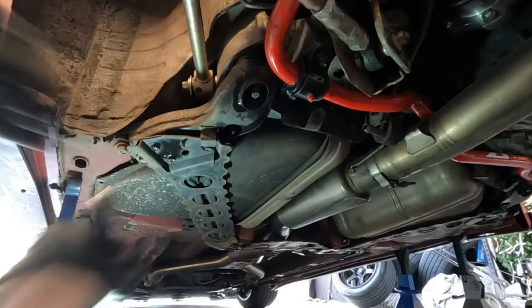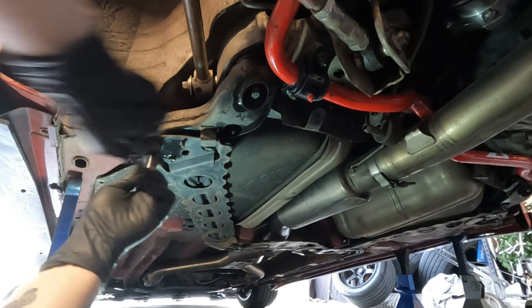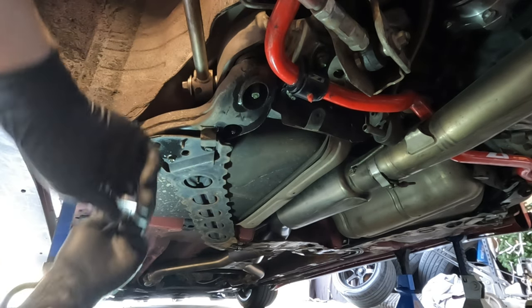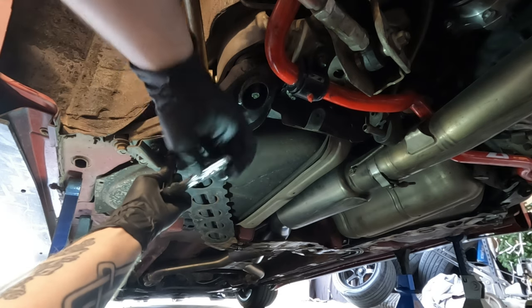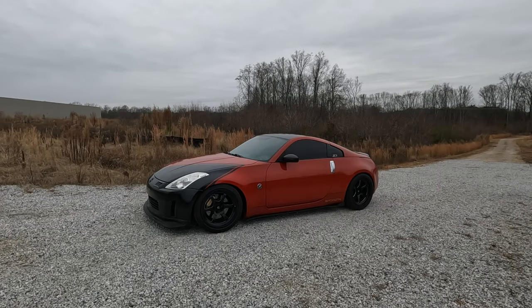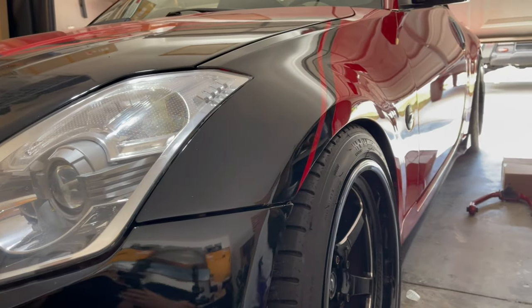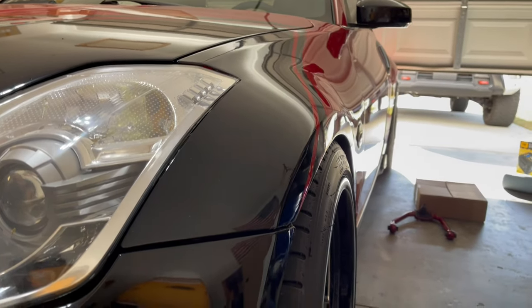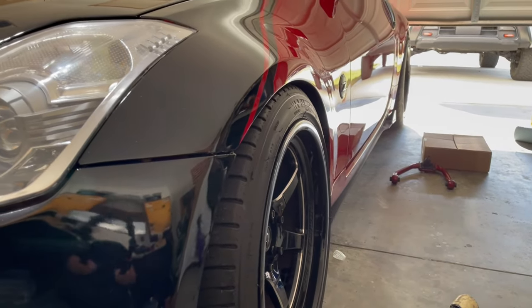Going into the transmission and clutch setup — we got upgraded clutch slave and master, a Z1 stainless clutch line, Z1 performance clutch kit with the lightweight flywheel, and an upgraded clutch fork. The older Z's had a really flimsy clutch fork that would bend and you wouldn't get good engagement. Fresh Amsoil trans fluid, the Z1 poly trans brace — that makes a huge difference — and the Mtech shifter springs that make the shifter a lot more firm, giving you much better feel. We also got Z1 poly engine mounts, which made a huge difference putting power to the ground.